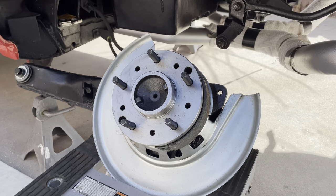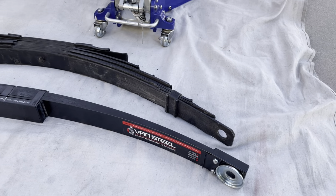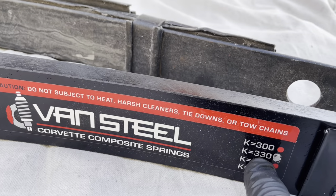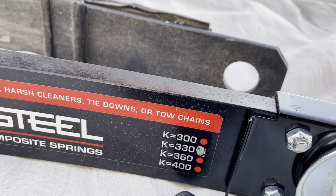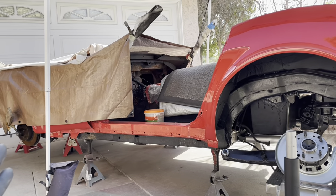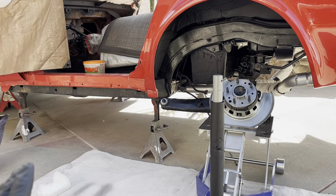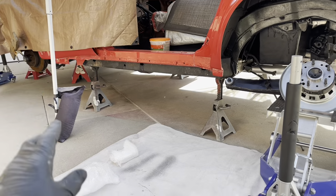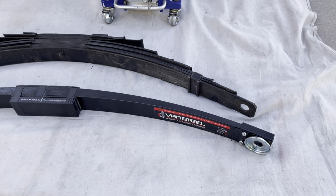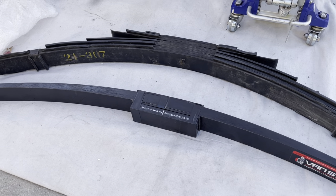So I know some of you will be asking about this, so I'm just going to make this video now. This is the Van Steel Corvette composite spring — it's the 3300, which for this car should be good. It's for a smooth ride; it's a small block, not making huge power. If I decide to upgrade it later, I might swap out the spring to a stiffer one, but for right now it's going to be a moderately powered typical small block Chevy.